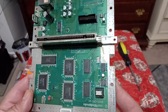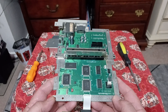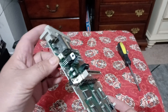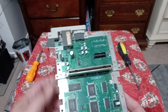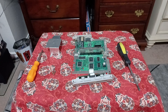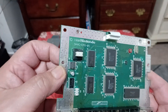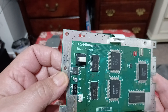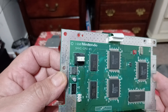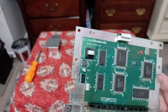I tested it and it worked out perfect. This Super Famicom has been preserved for another 30 years, maybe longer — with a better power regulator and better capacitors. To identify your board, look at the very top and you'll see your model number: SHVC-CPU-01. That's how you know what kind of capacitors you have. Now let's go to the Console5 website to order your capacitor kit.